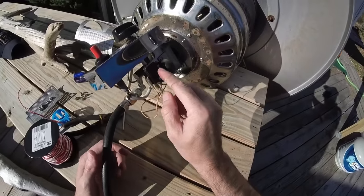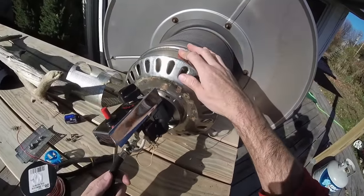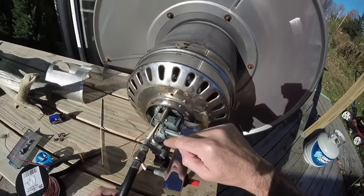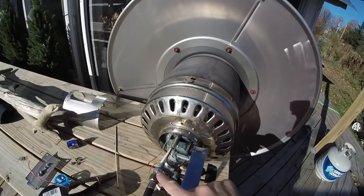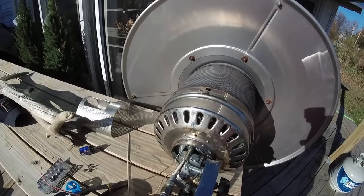There's your sparker. This is a little switch that is a safety switch — just in case you screw up, it shuts you off for five minutes and you've got to wait five minutes to turn it back on. What we're going for today is this little tube right here. This is a little copper tube that carries gas up through the tube and right up into the burner where it obviously does combustion and gets the flame started.